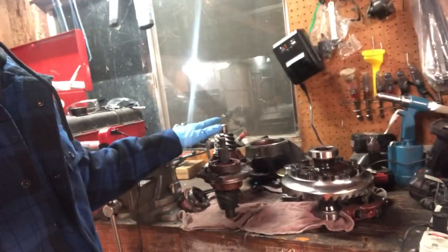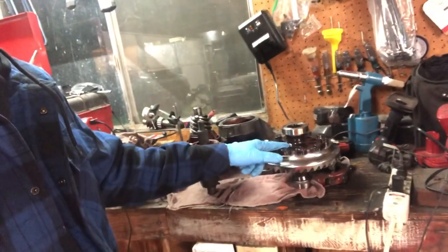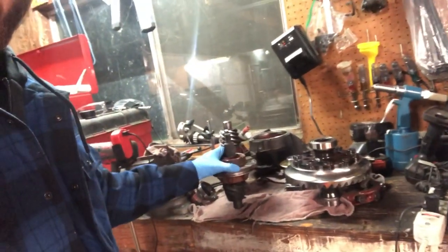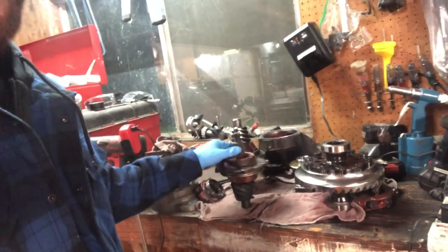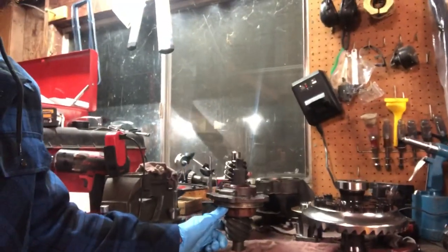He gave me a pumpkin that already had a 7.0 gear ratio inside. I'm basically just going to take the old ring gear off, reuse his spool, and then make a whole new housing with the new pinion gear and new bearings. Basically what I did is I just knocked this bottom bearing on with my special differential pinion bearing tool, which is basically just a pipe and a hammer. Then I use crush sleeves.